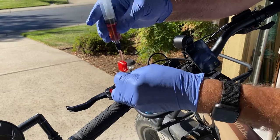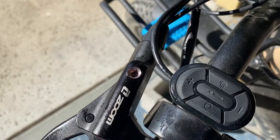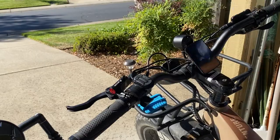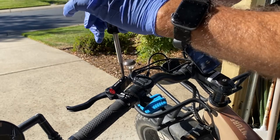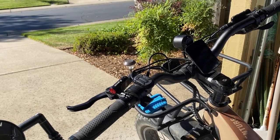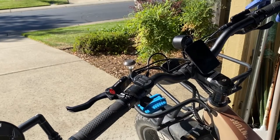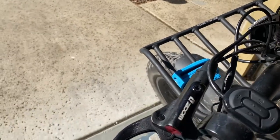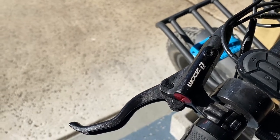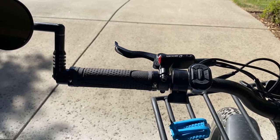Place the cap on quickly. For one final step, add a few more drops right at the very top to completely fill the cylinder, then tighten it down. Now test — brakes are nice and firm, no more mushiness. Be sure to clean the handles because mineral oil will come out when you're tightening up. Finally, adjust the handle back to the correct position if you moved it.